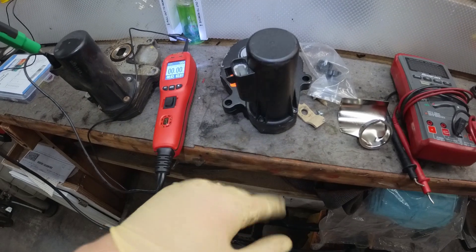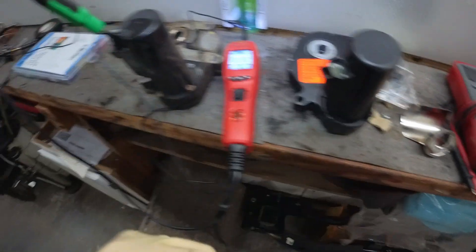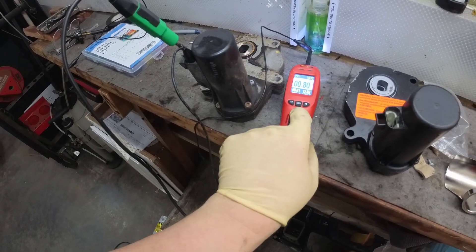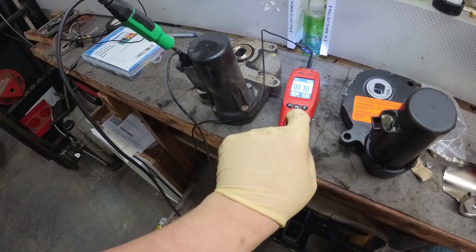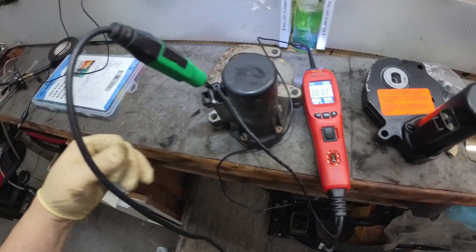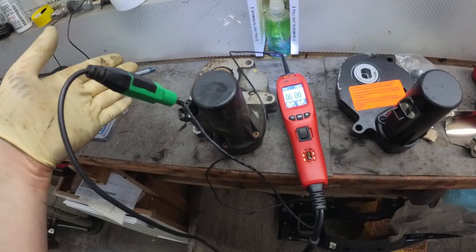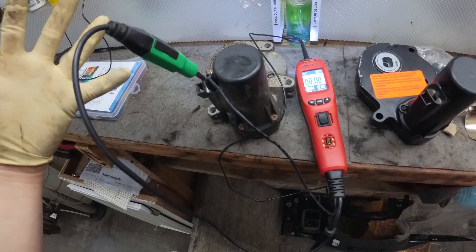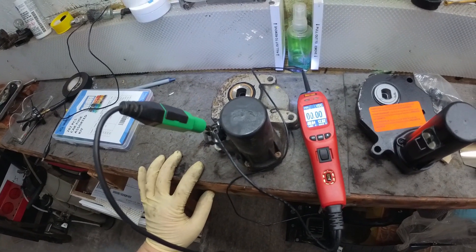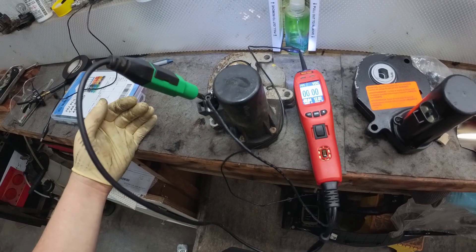I went ahead and picked up another motor just to reference what the normal number would be — this one is 1.3 ohms across these two pins, and this one is totally open. It has continuity to it but when I give it juice, we got no action. I think the transfer case module is actually detecting the resistance here and maybe putting in some sort of a detection voltage — similar to how headlight inoperative circuits work, where it puts out a voltage and measures the drop across that circuit. So maybe the module is not detecting the correct resistance for the motor and not throwing the 5-volt circuit on, so it won't try to operate without the system being complete.